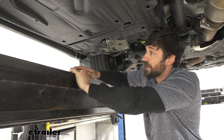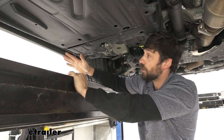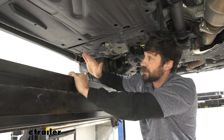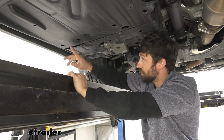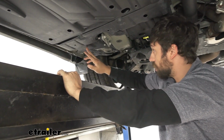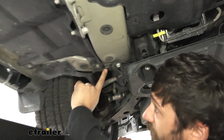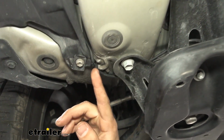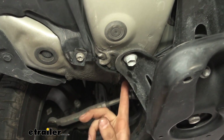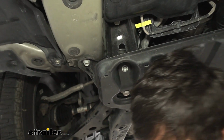Now we'll show you a grommet next to show you how we got that white wire up inside the vehicle. But the other wire, the black wire, that's the battery charge line circuit, that needs to go to the vehicle's battery. So we continued to run that wire all the way to the front. And you can see where it just comes out of our black panel here. We have a couple zip ties. And basically what I did from there is I went ahead and ran that wire all the way up into the engine bay, pulled it through, and we'll show you that a little later.